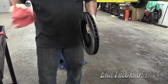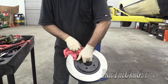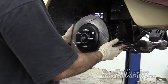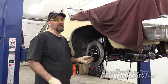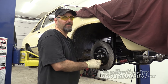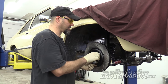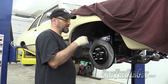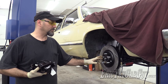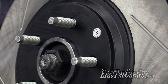These are massive and heavy, but they do look right at home, don't they? I was just laughing thinking these brakes are almost as big as the wheels that used to be on here — they were 14-inch wheels, and these are like 12-inch brakes. A little trick to help keep the rotor from going somewhere when you're putting the caliper on. Important note: these rotors are marked right and left — they're directional. So look for the R and L. This one's on R.